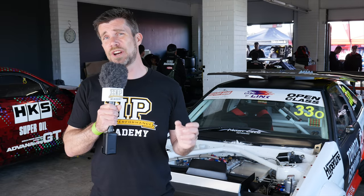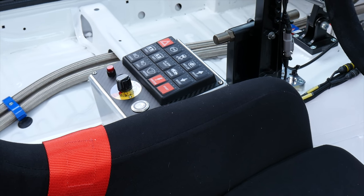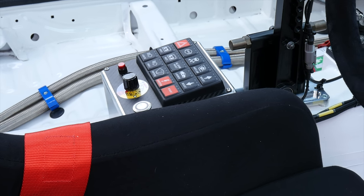But on top of this, there's also a 12-position switch that allows the driver to modify the braking effort or the ABS effort as he's driving around the track. This allows the driver to adjust the ABS effect based on the amount of grip available, from a bright sunny day with high grip levels through to torrential rain.